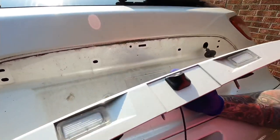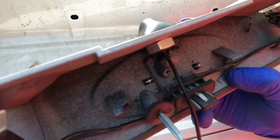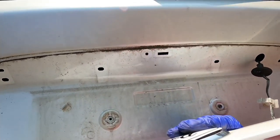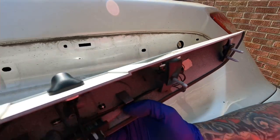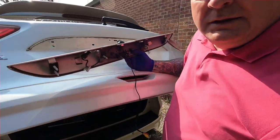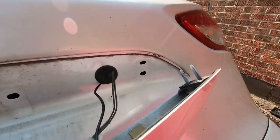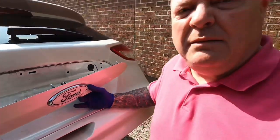After a lot of messing around, I've got it in — you can see it there. I did it a bit too close so I had to drill away a little bit inside there, but anyway it's in now, it's secure. I took the number plate surround off as well. So he's in — next bit is to feed the wires in through that grommet I removed. Instead of having to slice anything, I just pushed the grommet in underneath, so I've got to cut nothing. Now I can get it bolted back in.